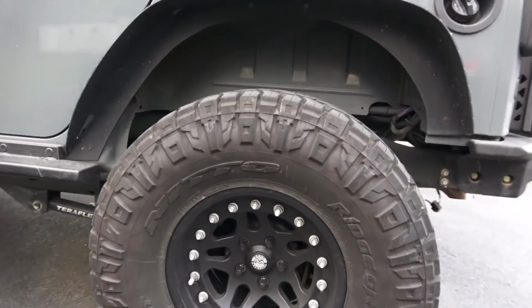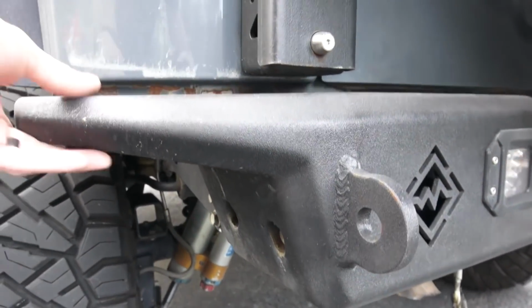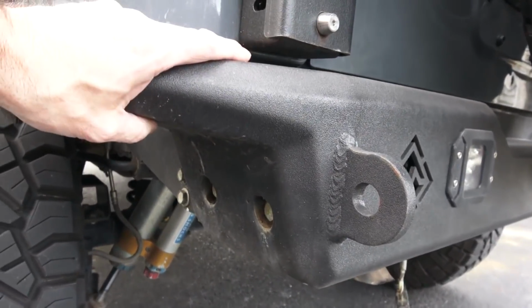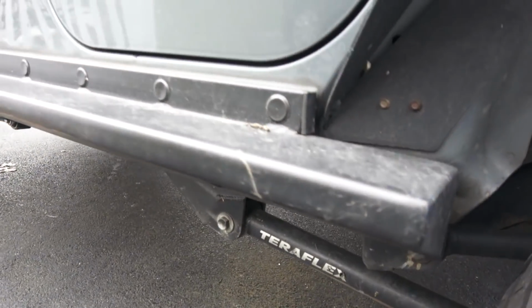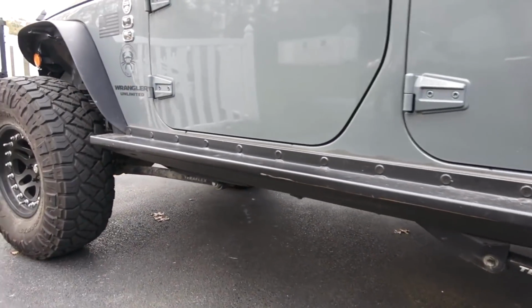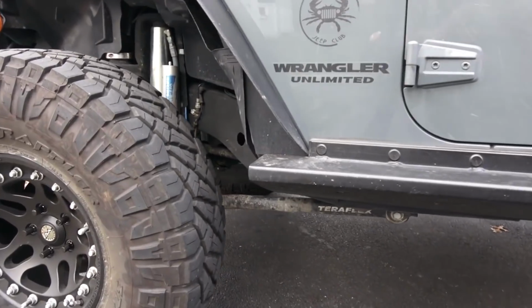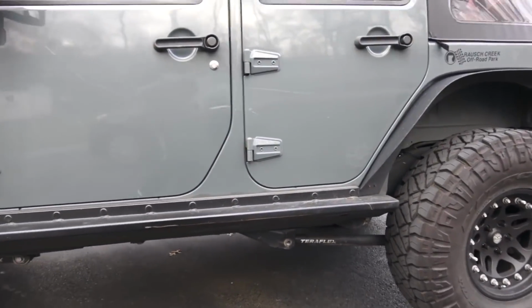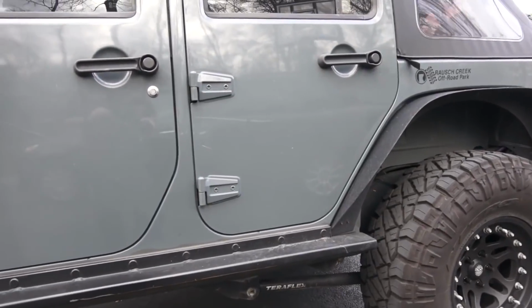So that's where a high lift jack comes in handy, and with that you're going to need some aftermarket bumpers, which might be like a co-component of the jack. I think you need to find something steel that you can lift from, whether it be steel bumpers or steel rails or steps or something like that, because the factory plastic bumpers on your Jeep aren't going to be able to hold the weight of the Jeep. So that's kind of a combination. A way to jack your vehicle includes the jack and those lifting points. So that's something I would highly recommend you figure out.